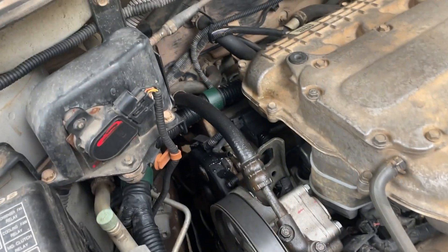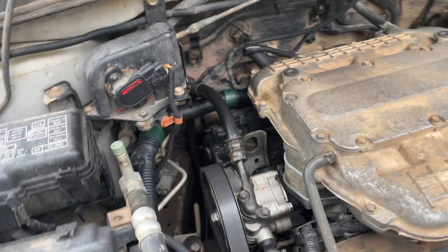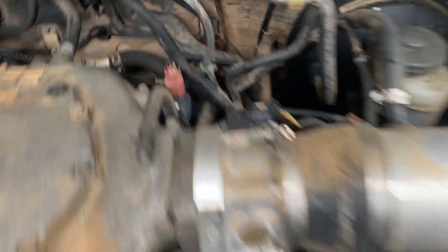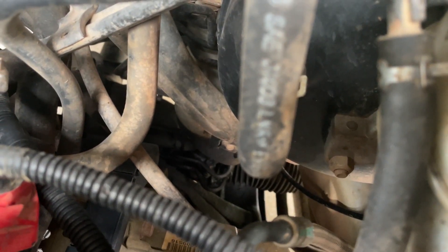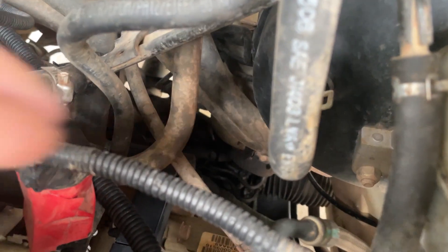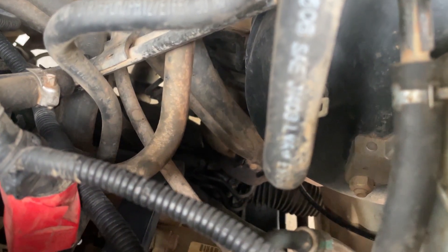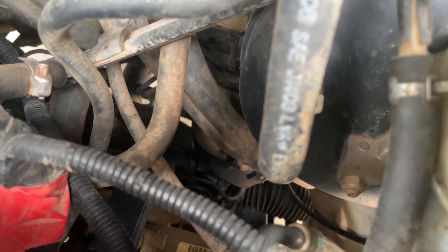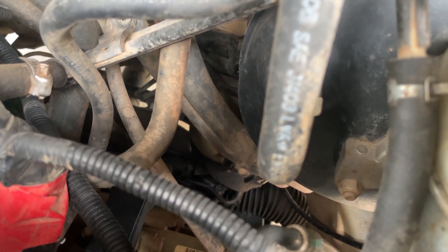So I bought an actual power steering cooler to replace the one on the front, and I'm going to replace this top tube as well. The challenging part — just getting it in and out is hard. Where it goes into the rack and pinion down there, kind of center on the screen, is very difficult to reach. Most DIYers have to reach it from the top. I've got to get under the car because I have a subframe drop, so there might just be a chance I can get to the back fitting from the bottom.